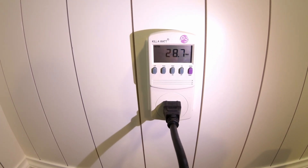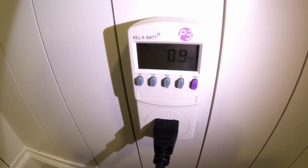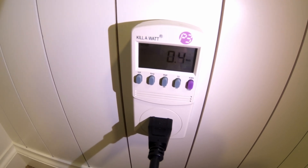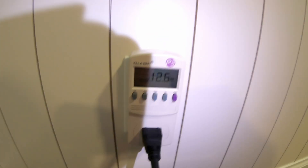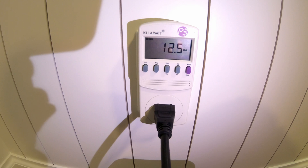We'll see what it actually does once it completely charges. The UPS has finished charging and it's off — nothing's plugged in besides the UPS itself. In off standby mode you can see it's using 0.4–0.5 watts according to the UPS display, but in reality in standby mode it's consuming 12.6 watts just on its own.